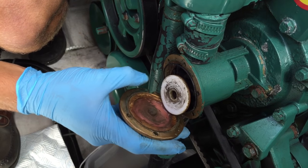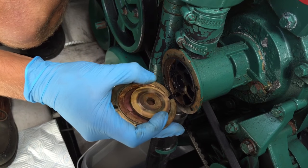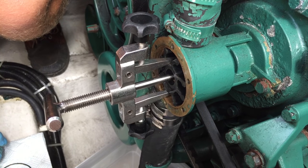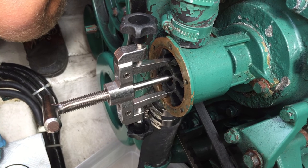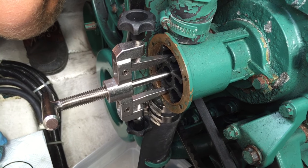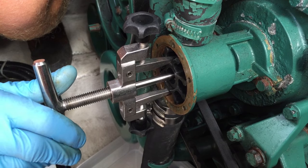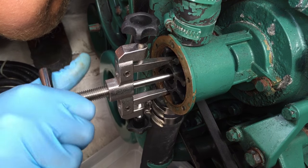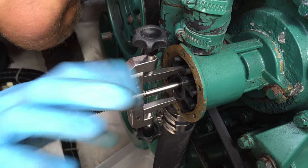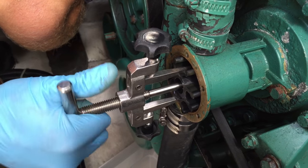As the cover comes off you'll see there's a plate which presses against the face of the impeller, and a little rubber ring which creates a watertight seal when the cover is back on. We're using the correct impeller tool here — you turn the black handles at top and bottom to grip the impeller tightly, with the center handle fully withdrawn. Then as you turn the center handle, the impeller starts to pull out of the housing. Sometimes it slips a bit, but with luck it draws straight out — this one is coming out beautifully.